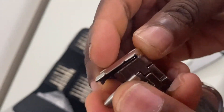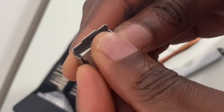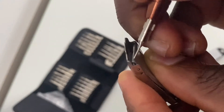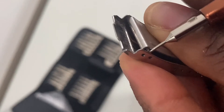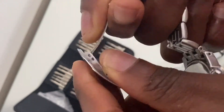Make sure it sits at the floor position first, then install it at the other end of the slot. Make sure it sits on one side of the strap first — the first bit sits on this end, and once the link has been slotted into the hole we can proceed to fit the other link into the other slot. With the aid of your screw bit, push the other end of the link — it sits on a spring so it retracts backwards into that groove — then slide it underneath the slot so it springs back and glides into its original position. If it doesn't get into the groove right away, use your screw bit or use your hand to feel the link slide into the slot. You can see it's in the slot and it's a steady connection.